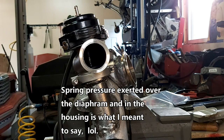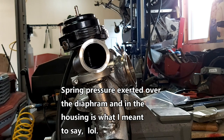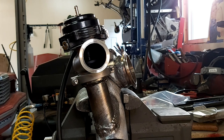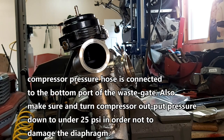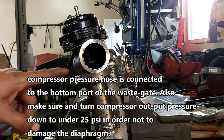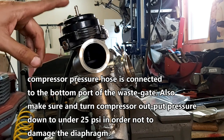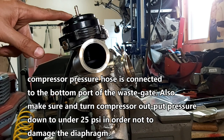So what I've devised is a system using air pressure. Once I actuate this, it'll lift the valve off of the seat, and this way both the top and bottom V-bands are basically touching each other and you can put this clamp on super easily. Because if you try to do that without it, depending on how much spring pressure you have on your diaphragm, you'll never get it — it's super tough.